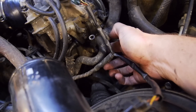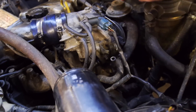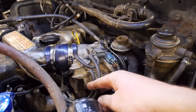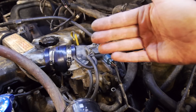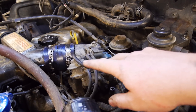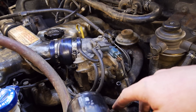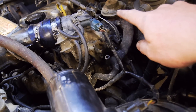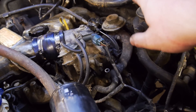We've also got this cast pipe that goes from here all across to the bottom of the throttle, so that will be coming off. We'll be blanking that where the intake manifold is, deleting this whole section, and doing a little bit of trickery with the vacuum lines so that we can basically have the butterfly valve open when it's running. A lot of guys say to just drill the rivets out on the throttle and take it out, but it does induce a bit of a rough shutoff. There's an easy way to do it with these vacuum lines, so I'll get to that later.